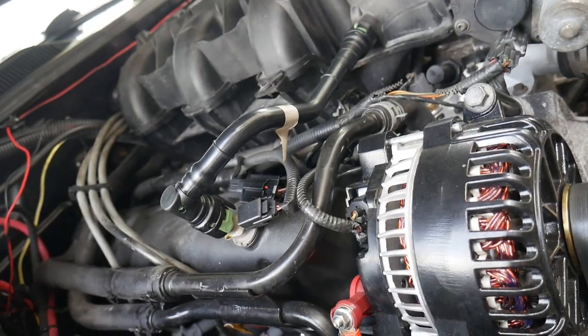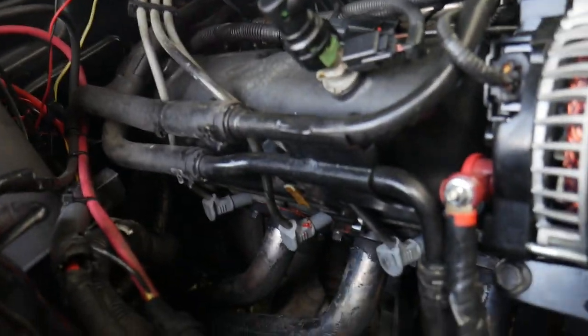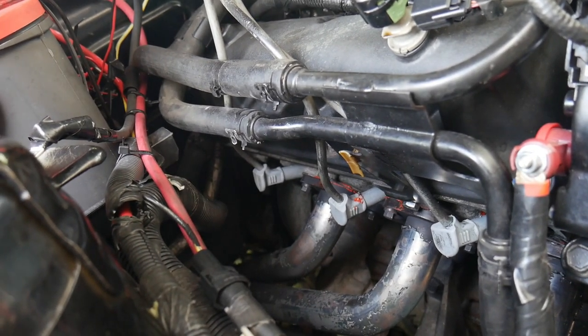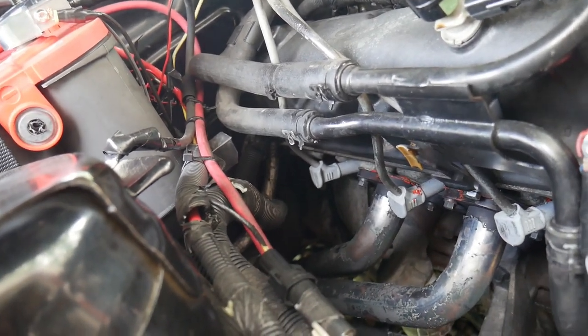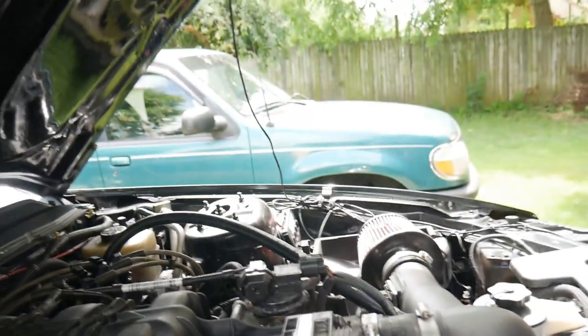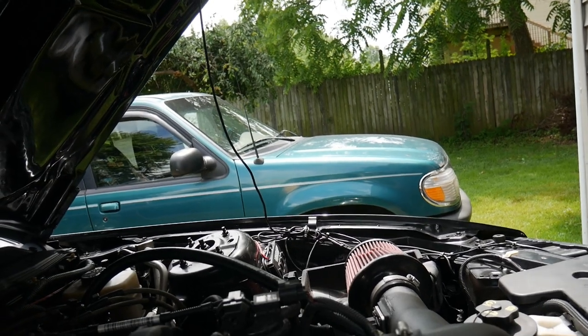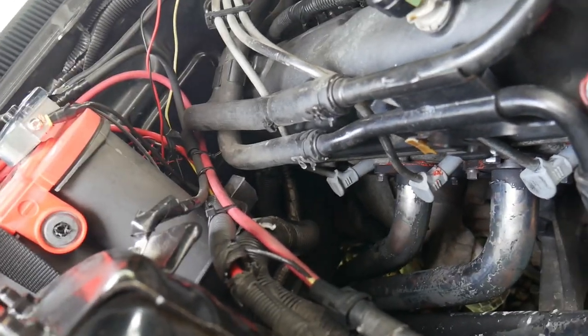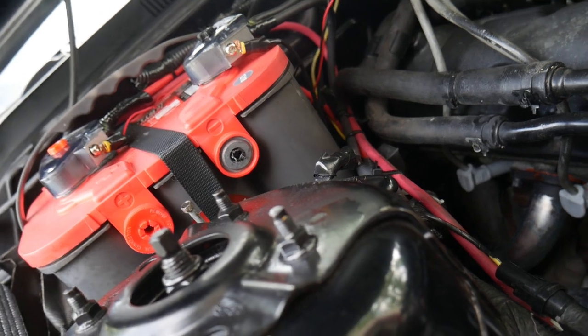We are running two 1300-watt subs and the amp is 1400 watts. If you go by the chart, it's recommended you have one gauge wiring for that. But I've never used one gauge wiring — I've always used four gauge, and I used eight gauge with that system for over a year and a half in the Explorer without any problems. So we're going to run four, maybe three, maybe two gauge — we'll check out the pricing and go from there.